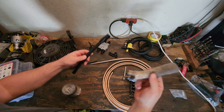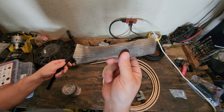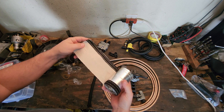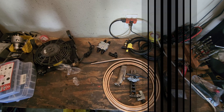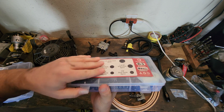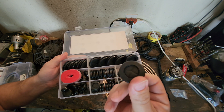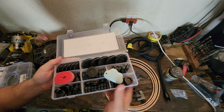Other things that are pretty cool when it comes to protecting your hose — it's got that fiber mesh, high-temp jacket. They use these for spark plugs too to protect them from high temperatures. You can get this jacket, cut it to length, it folds over on itself and acts as a heat shield. Also important when routing oil lines through any kind of metal — say you drill a hole in your firewall or run through some tins — is to use grommets. Grommets are super important because these VWs vibrate quite a bit. Road vibration comes up through the metal and will cut right through those fuel lines and oil lines. Getting a nice little kit with an assortment of different grommets is a great way to protect those lines whenever they're passing through metal.